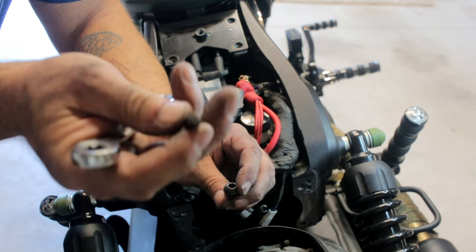In order to get the license plate light off the subframe, it was two six-millimeter bolts. This plastic guard was over it protecting the wire — I took a straight screwdriver and just pried under it. It's held on by these little plastic things, so don't worry about messing them up because they'll go back in. Now I've got this wire and I can start to fish it out through the hole. I need to unscrew this — it's an eight millimeter. I'll remove the bolt at the end here because that's holding the whole tube on. That allows me to get the wire all the way out. Set that aside because I'm going to reuse that.